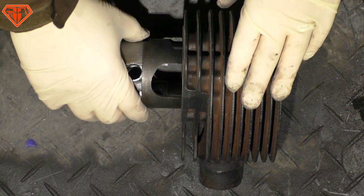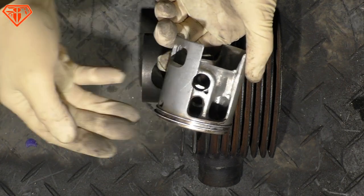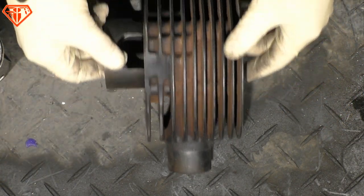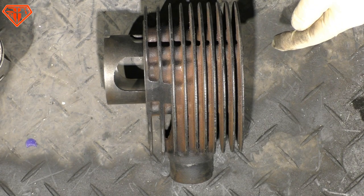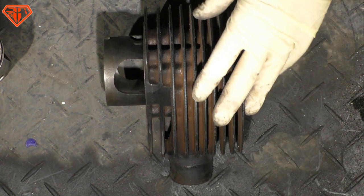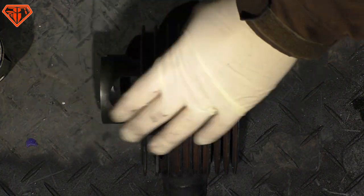Because not only did they finally exchange the piston to a state of the art Malossi style Meteor piston, they also included a cylinder head. Because ever since, you just got the cylinder and this amazing piston, but no cylinder head. So a lot of people were tempted to use the original cylinder head. Some Vespa dealers in Austria, very well known, did even recommend you can use the original cylinder head, which is bullshit, because 198cc is not 207 or 208cc.